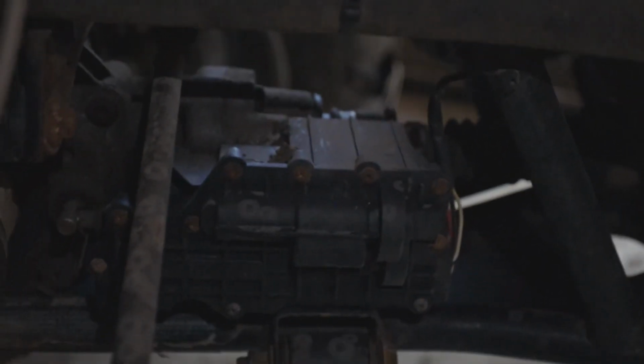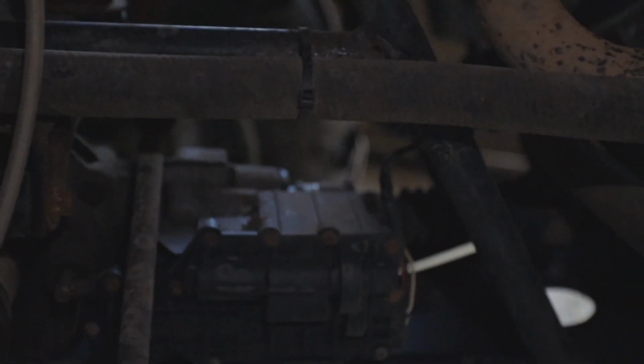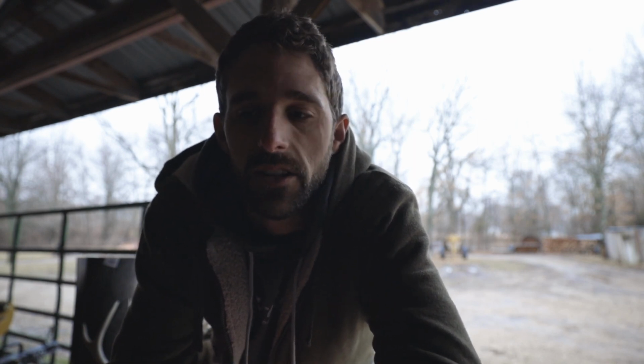make sure there's no bare or broken wires anywhere along the wiring harness, and then you're going to go further and check into your four-wheel drive actuator. Make sure that it is good in there. Depending on how mechanical you are, you can open up the actuator. There is a little motor in there, and there's a circuit board. You can test all the circuitry in there, see if there's any burnt things in there.